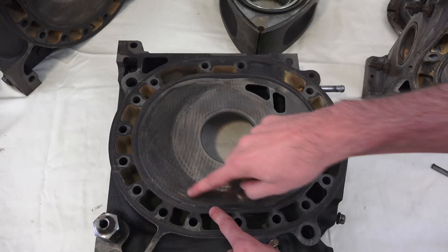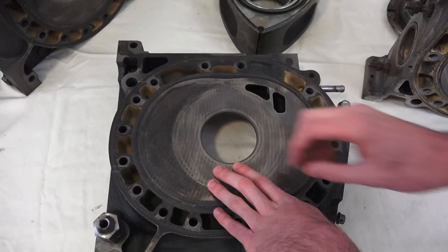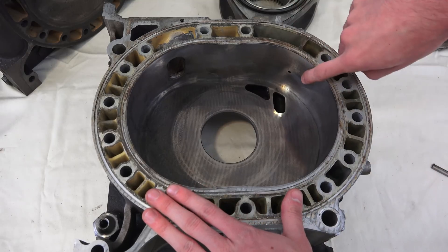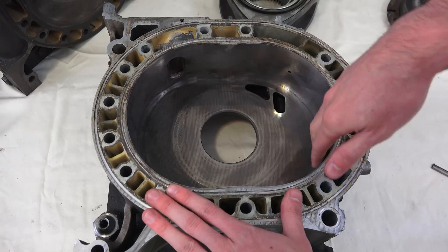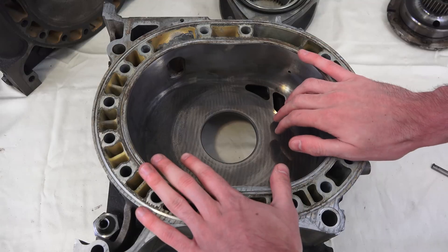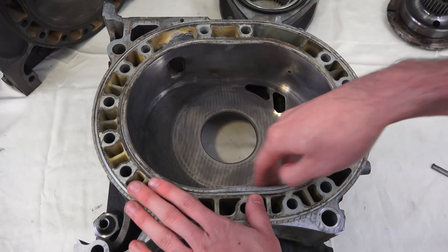Because of that, you can have some of the air in one pocket getting over into the pocket of another chamber. Now in order to help ensure that there is a seal, you can see here this hole which injects oil into the combustion chamber. That's to help maintain a seal around the edges and lubricate them so you don't have any wear.